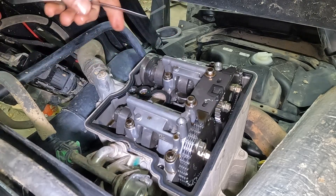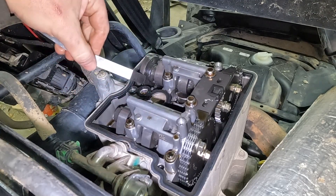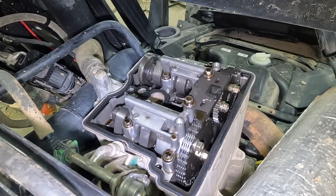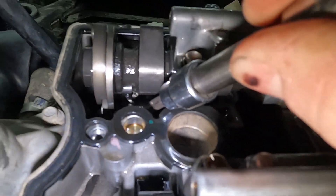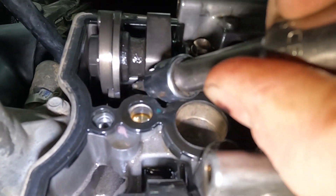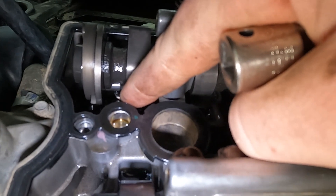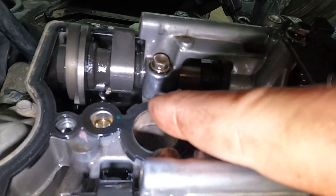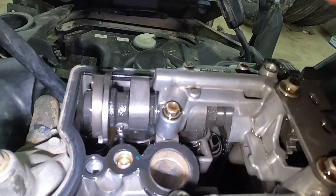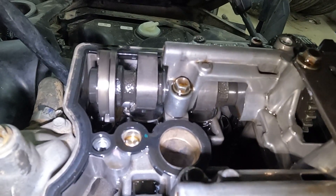Here's what's happening — I know what's going on. This one is all the way up. This one, I can actually see the decompressor pushing on the exhaust. See that little pin right there? It's pushing down on the edge of this tappet. That is the decompression system right there. This is centrifugal force — it swings that out when it's just sitting still. When it's moving, it pulls it back so that you get a good seat on it. So that's why my gap is so big on that exhaust side. I'm going to turn this engine to top dead center, which I probably should have done in the first place, and we'll try that again.